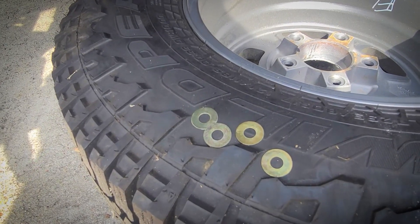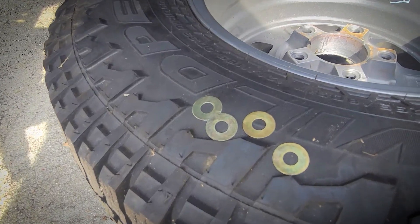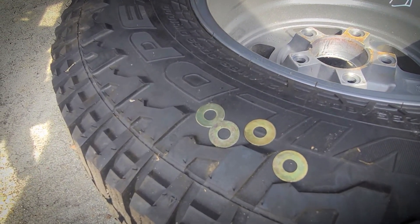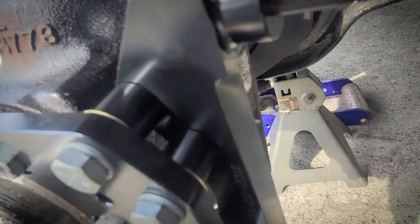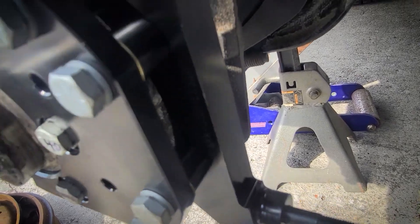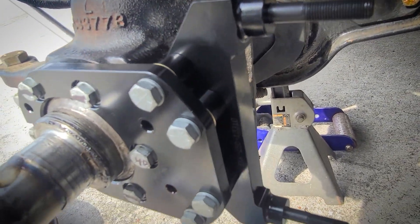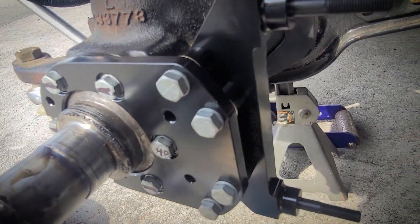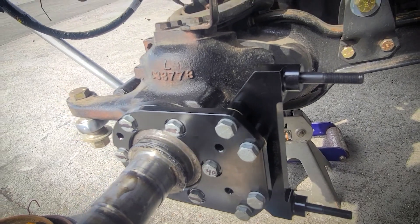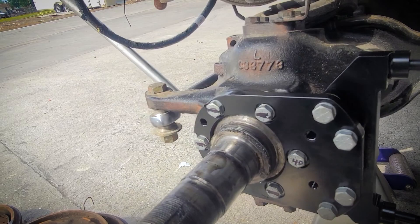The kit comes with two sizes of shims — these are the thicker ones; look in the book and it'll tell you what they are. And then there's a paper-thin one. I took one of these out from each of the bolts and they were about three quarters of a millimeter. So now we'll get the rotor back on, get things tightened up, and see if the caliper lines up. Hopefully when I swap calipers — because I've got them backwards right now — everything still stays the same.